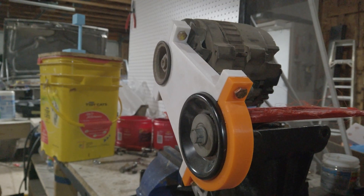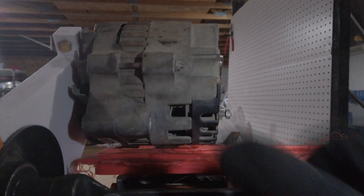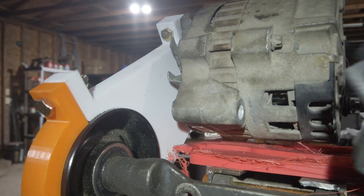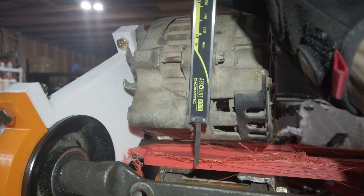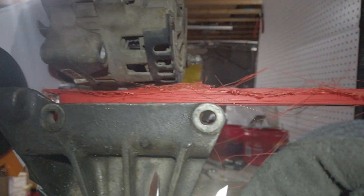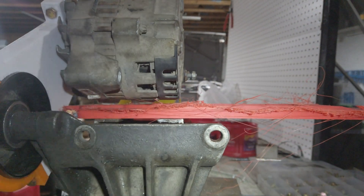So this is what we're working with: we got a new pulley in place and I've got the alternator. This is a failed print that found new use as a spacer. I've got these two little pieces of metal — those little holes kind of go onto this hole right here, there's gonna be a bolt and that's how the alternator mounts. As you can see, this hole matches up with that — look how far down into the bracket it goes. So I cut this way off. What we did was put the caliper here and that's basically where we want it.